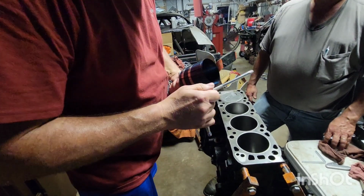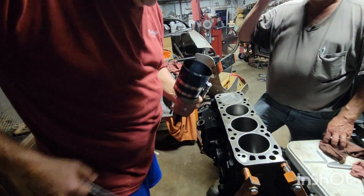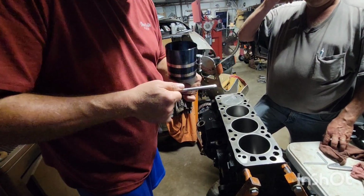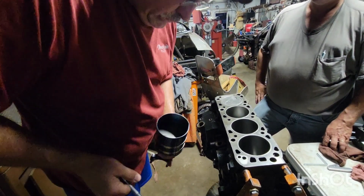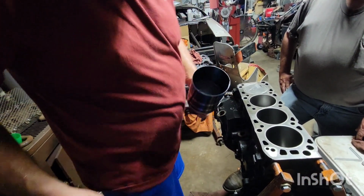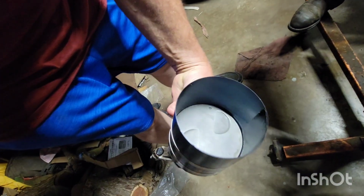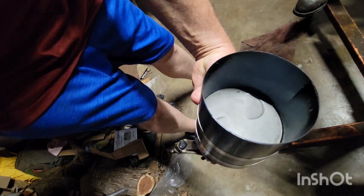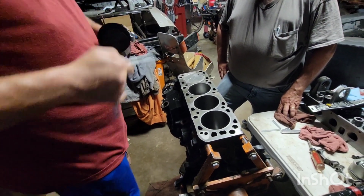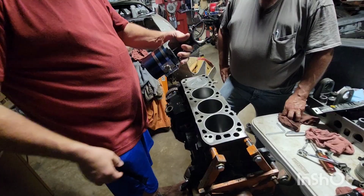Okay. Tap your ring compressor, make sure it's snug and flat. Go around, tap, make sure your rings are seating in your piston. You always look down and make sure. You probably can't see nothing in there, black holes it is. But you make sure the rings are good and seated in there. And you give that a good snugging. We give this a good lubing.